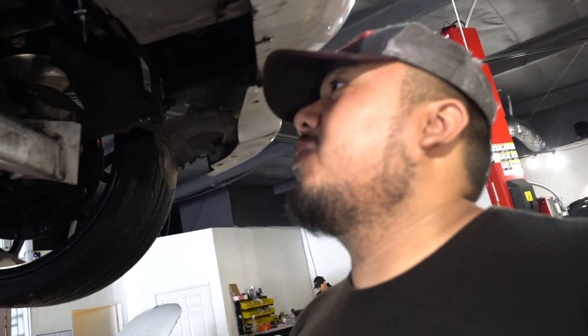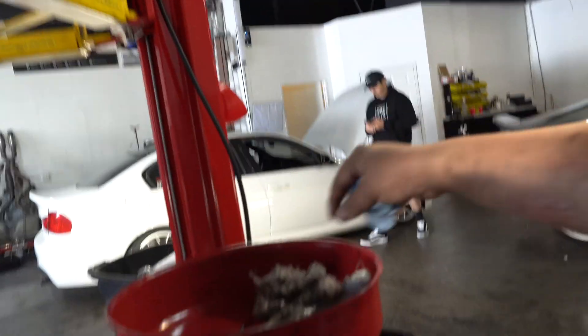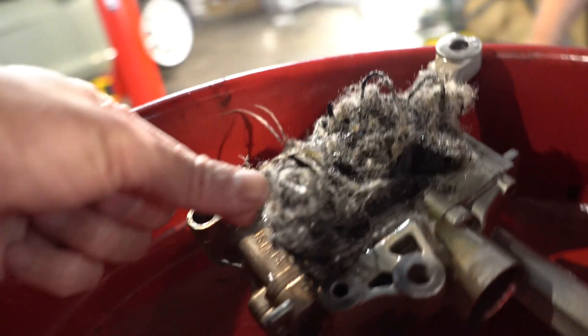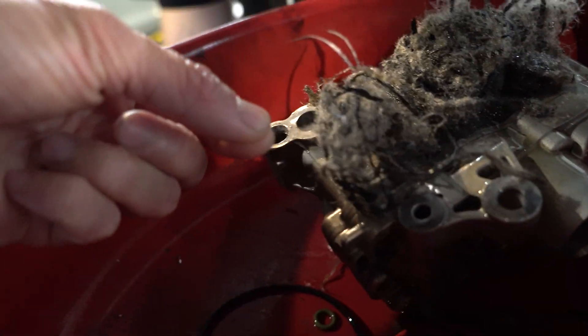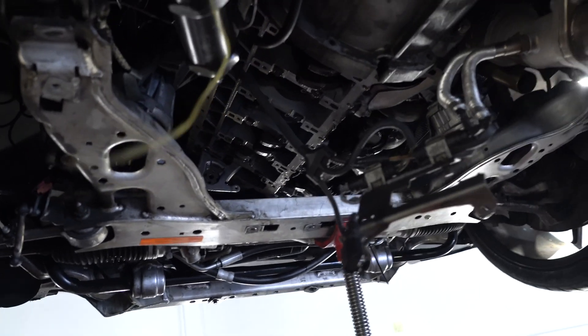There's probably a lot of small fiber still inside the passageways. Those small fibers turn into clumps and then you get issues. At this point we're going to remove the valve cover, inspect everything up top, and then give the owner a call to see what he wants to do. Chances are he's going to want us to remove the valve cover, extract what we can, run the car again, and if it happens again we'll pull the motor. At that point it just becomes too risky to rely on the oil pickup filter and oil filter to catch all the fibers.